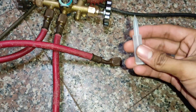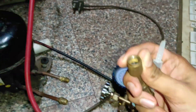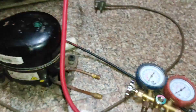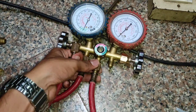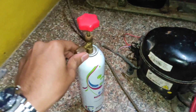After confirming no leakage, you have to remove the external compressor connection and add anti-moisture according to the atmospheric condition. I am going to fill the anti-moisture into this pipe. Here you can see I have already filled the anti-moisture into this pipe. After that we have to connect it to the R134A gas.